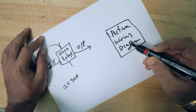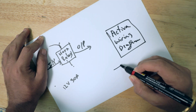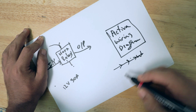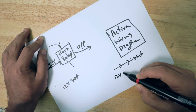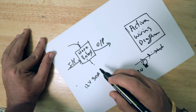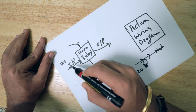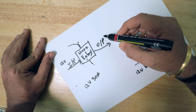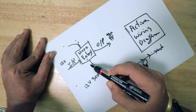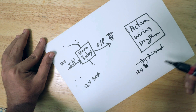According to the Activa's wiring diagram, the wire which goes to the headlight also goes to the tail light. Which means, if I give 12 volts supply to the headlight it will also supply the tail lamp. To understand the relay in simple terms: this will be the 12 volt input, the output will go to the headlight, and the trigger signal will come from the light switch which controls the voltage going to the headlight.